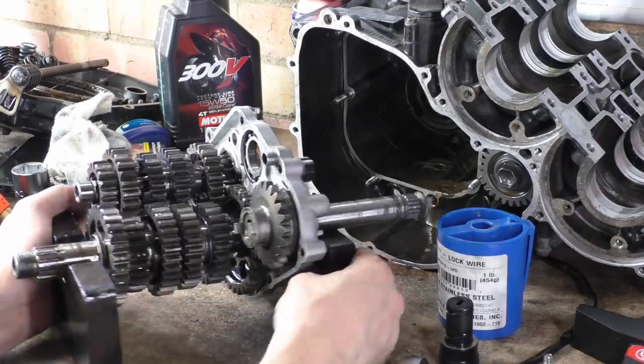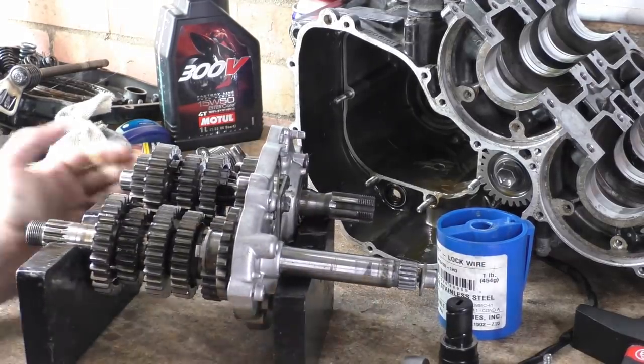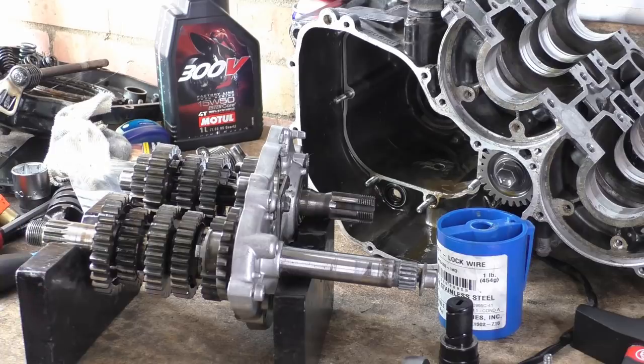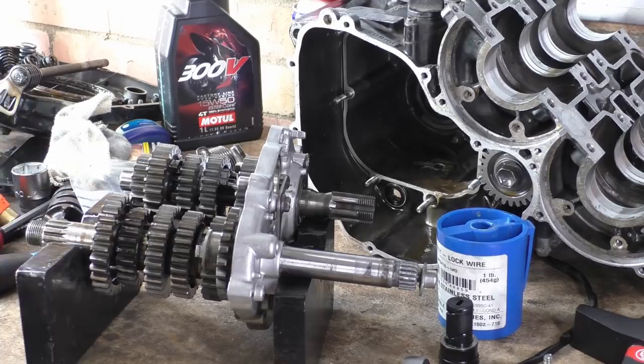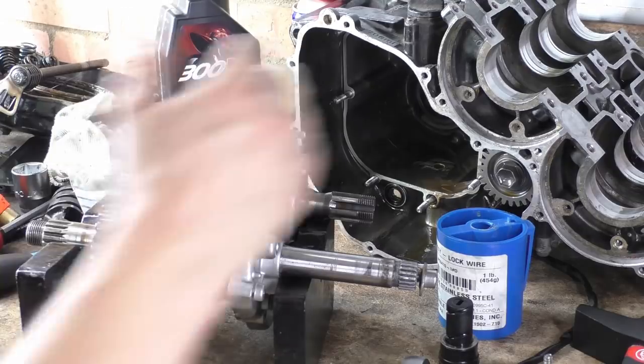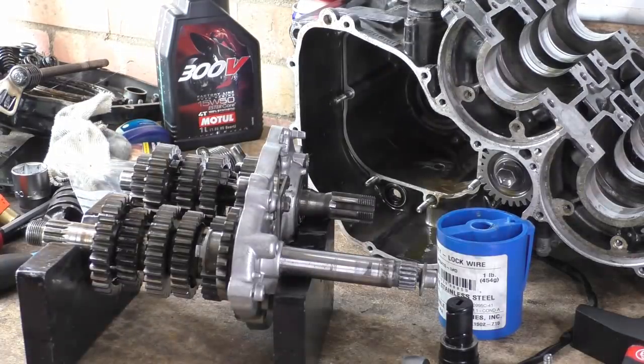What else about this entire gearbox? Well, it's a cassette gearbox to a degree. You can get cassette gearboxes where they have the other half, basically the blanking plate on the end. So it's a cassette gearbox to a degree. You don't have to split it, but they really had no option because they'd already put a split line. They'd have to put another one in, which is just more castings and more bad ideas.